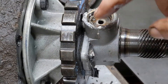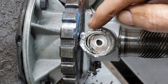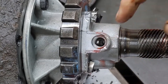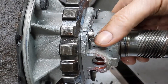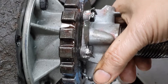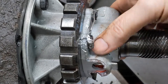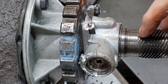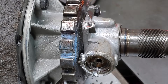You can see the governor took a beating. This is probably where it got beat up by a loose piece, and I suspect this is where the loose piece came from — this just completely snapped off. Smashed up in here, this is all cracked up. The parking gear looks like it's probably still fine — my guess is because it's steel and all of this was aluminum. So the reality is this is probably just fine. It needs a new governor, and obviously the case has a big hole in it, so that would be a problem.